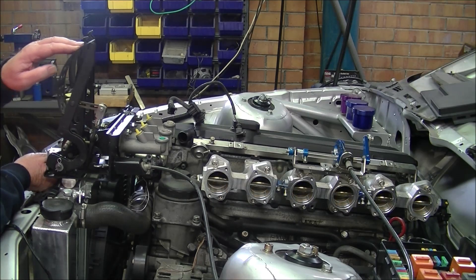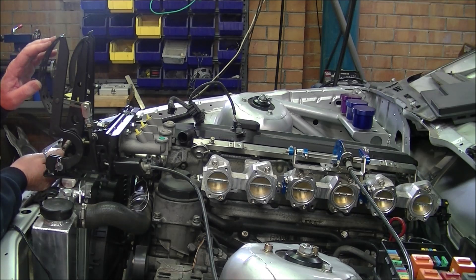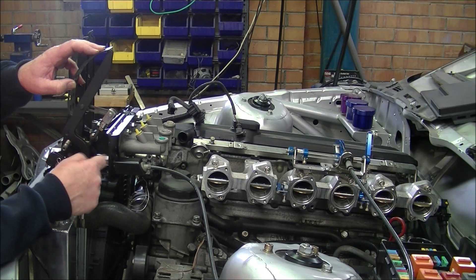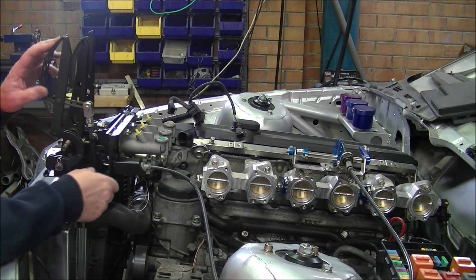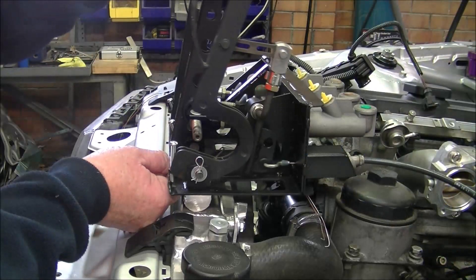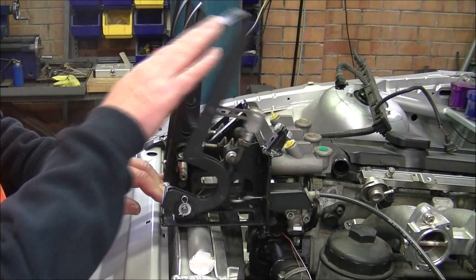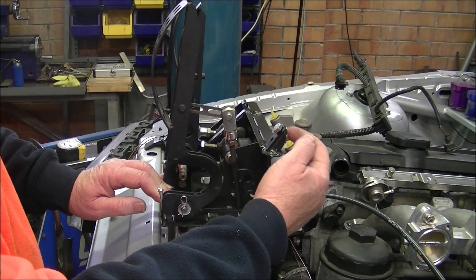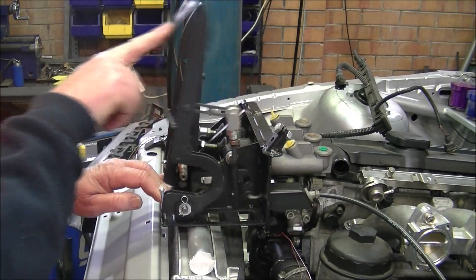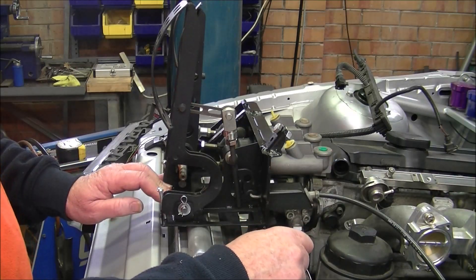And there we have the whole throttle linkage exposed — this will be bolted into the car, but that's what it looks like when it's all a unit working. The next job I have to do is put a stop plate here; otherwise, when you're on full throttle you'll be pushing too hard and possibly break the cable. With the throttle stop, the 8mm bolt goes in here — back that nut off, there's a captive nut there, back that nut off, adjust the bolt, lock it again, and that will give us a stop point without bringing the cable to a point where it's going to try and stretch and break.